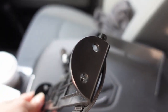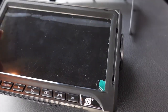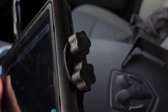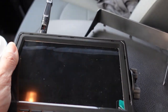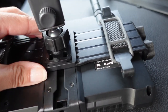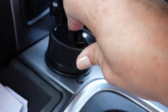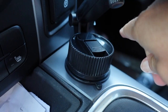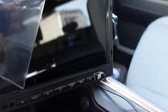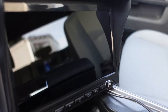First we're going to get the brackets and hook up the monitor. We're going to attach the back plate to the monitor, screw in the little fittings, flip the monitor around, and put the bracket in. Then we're going to use the suction cup and place it right there on the console of our Dodge Ram pickup. We'll take the plastic screen cover off and put the sun visor plate on where we can stop the glare and see the screen.